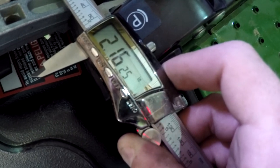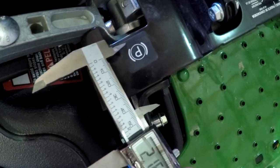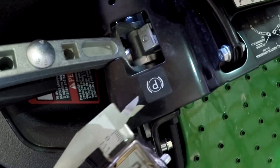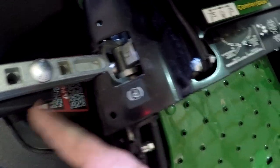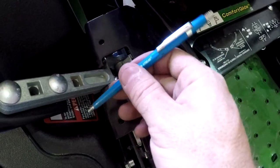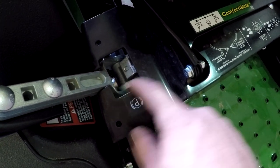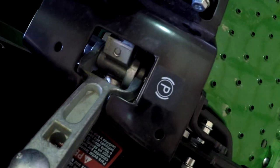2 inches, 162.5 thousandths, something like that. Anyway, I want to increase the size of this hole a little bit, maybe between a 16th and an 1/8 of an inch, and see if this side here gets faster than the other side with the bolt in it. So I'm going to mark this out here with my marking pencil, and we'll take a Dremel or a die grinder and cut this out with a carbide burr, and we'll go take another speed run.